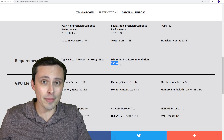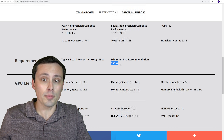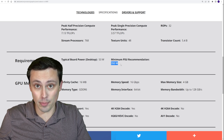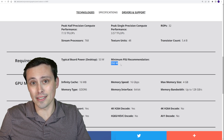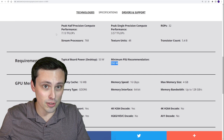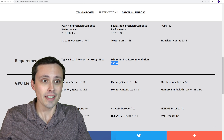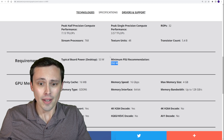Although you do want to be careful with that, because not every prebuilt will actually be able to deliver the full 75-watt spec through its PCIe lane. So you want to be careful and not just assume that every PCIe lane can actually deliver that much power.